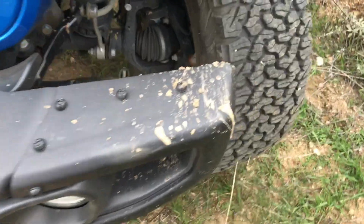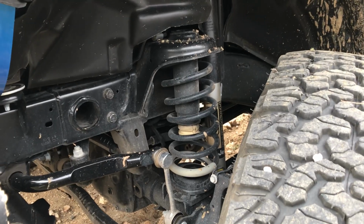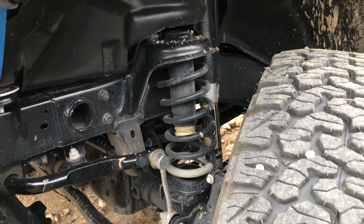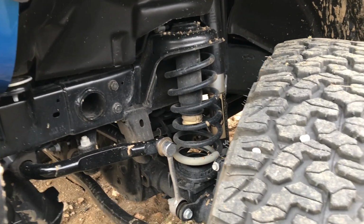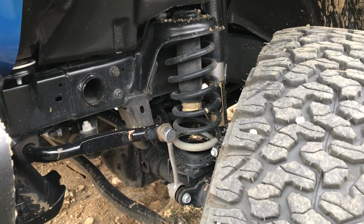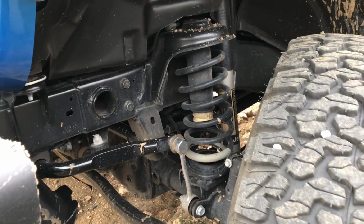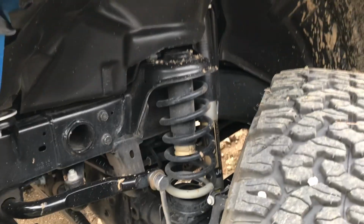Moving on to the suspension, I really think that this could benefit from a performance shock. The shocks are valved very soft on this Jeep. So a shock with firmer valving, or better yet, adjustable valving, a high-end large diameter shock that can dissipate the heat with compression adjustment or overall adjustment, like an external bypass type shock, would be great on this.